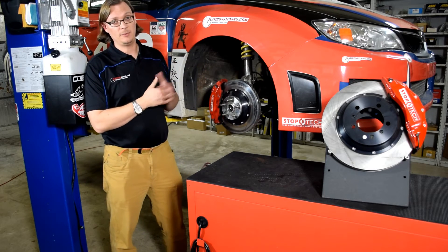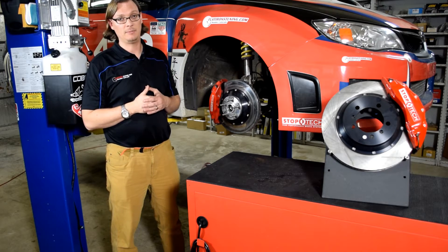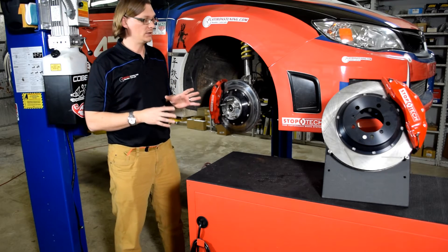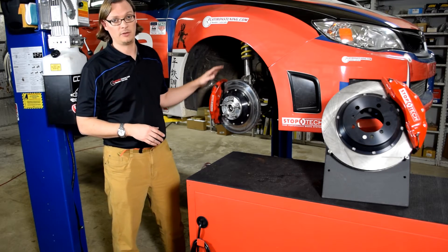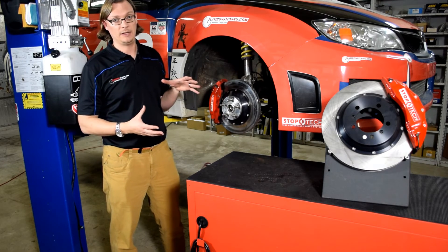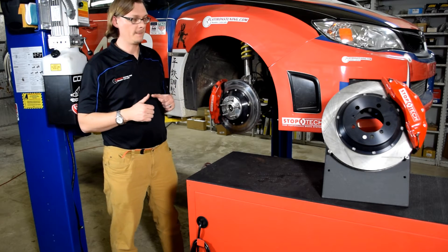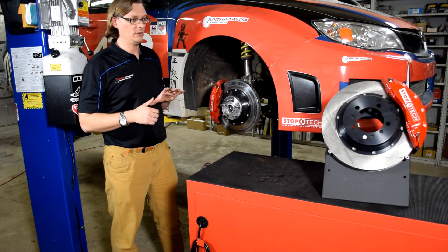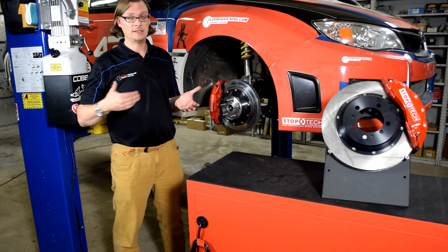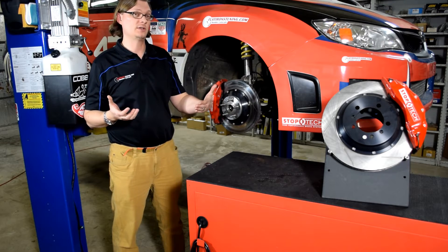With our 2014 WRX, going in when building it as a race car for the first time, we wanted something more capable than stock brakes. We used a different two-piece rotor and lightweight aluminum caliper — slightly larger than the stock WRX brakes, approximately the size of a Legacy GT rotor, different from the StopTechs we have now. We saw a decent improvement in consistency, but we actually measured that we had increased our stopping distance.